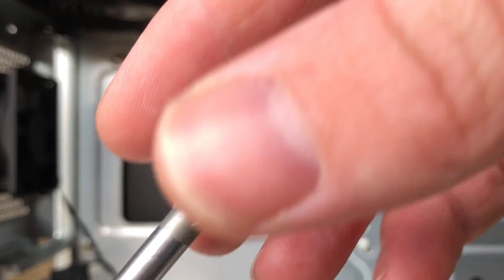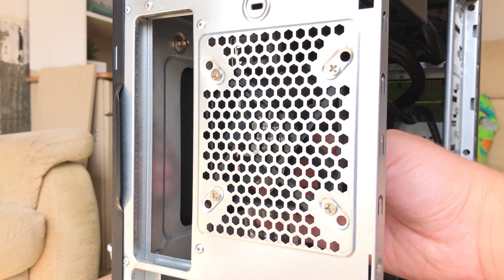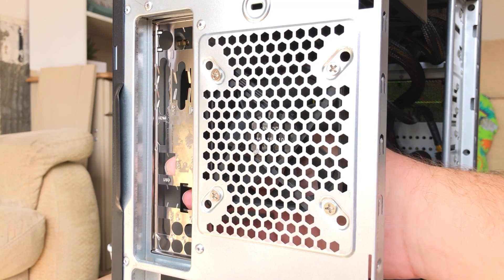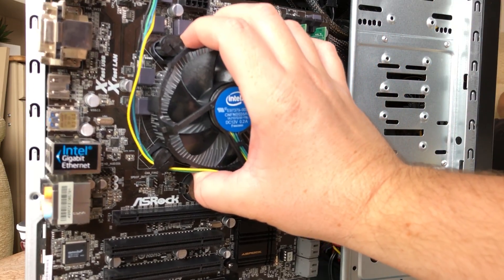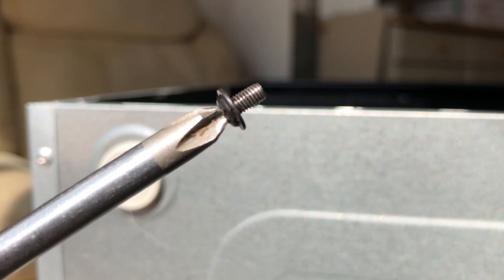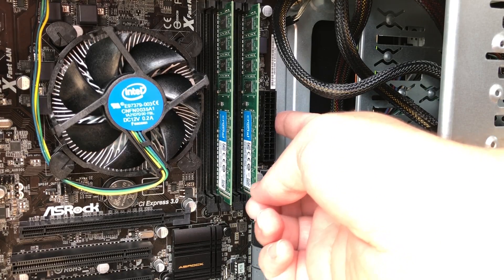It's a magnetized attachment for the end of a screwdriver that usually comes with new PC cases but can be found online for cheap. I'm not sure of the exact name — I just call it a motherboard standoff screw thingy, but it's not called that. Luckily the standoffs are already in the right place for this new board; we just won't be using all of them as this new one is a little bit smaller in form factor. The motherboard can be sat on top of the standoffs ready to be screwed into position with the same screws we removed earlier. Then it's just a matter of putting all the cables back in the right places, including case and power cables.